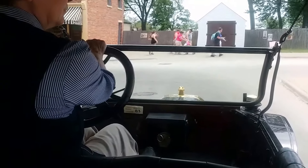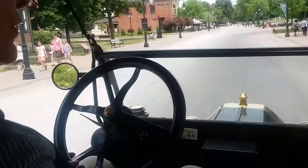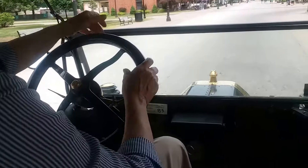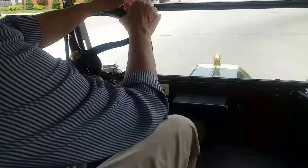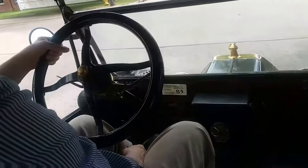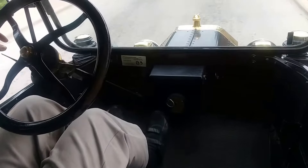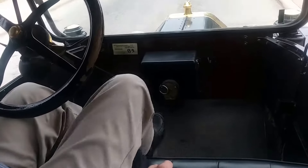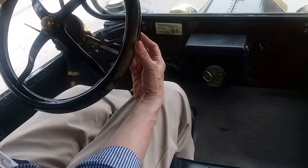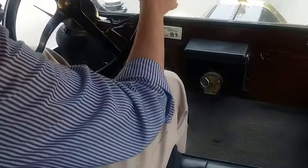It's about like the Volkswagen Beetle '68 that I learned to drive on, because it is what you might call a semi-automatic transmission. Your accelerator is up here — a lever by the steering wheel. That's where the gas happens. This pedal halfway down is your neutral position. You can apply this pedal for the brake. Move your foot over to that pedal and you back up. To go forward, you press that pedal to the floor to get low gear, let off the gas, slowly let the pedal rise to the top, and now you're in high gear.